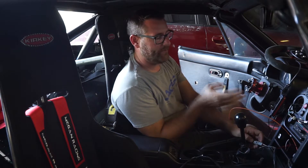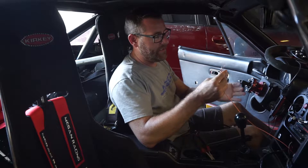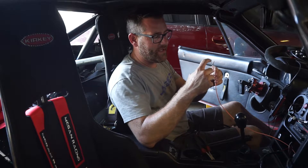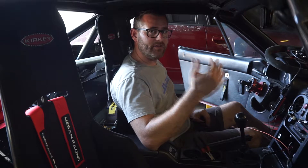The wideband — they generally say not to hook it into the power from your AQ-1 or something like that; pick a standalone power source. But this time I'm going to wire it up so that I have all four. I'm using a piece of wire that has four conductors — that way I can have CAN high, CAN low, ground, and your 12-volt source, so it can actually power your gauges at the same time.